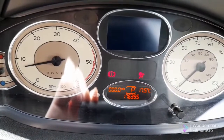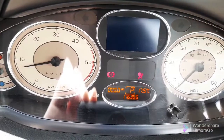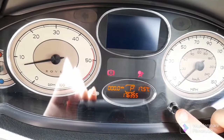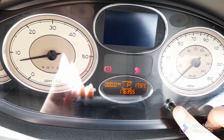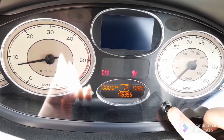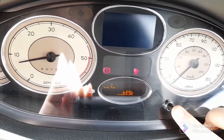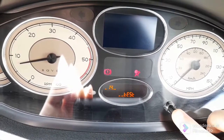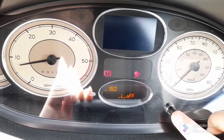What we're going to do now is test to see what temperature the car's running at. Apologies for all the reflections here but I'm going to go into diagnostic mode — I might not get this first time, it's a bit of a footer. This will show the true temperature the car's running at. The temperature gauge on the 75 is just for decoration only. So we press it and hold it once, then we quickly go to number 19.